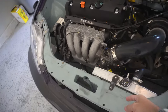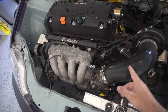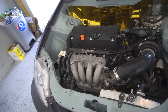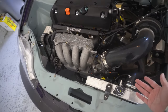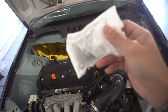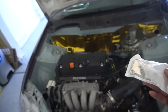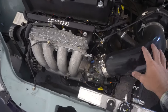I also have a KPro ECU and on the laptop before I did see that it was giving me an error code for the idle air control valve, which is right over here. When I installed that idle air control valve it was a cheap eBay one, I got it for like 20 bucks — OEM ones go for like two or three hundred. So I think the idle air control valve is bad, and since I do have KPro I have the option of putting a cover plate over it and then in the computer I can go ahead and disable the idle air control valve.